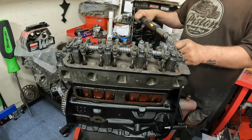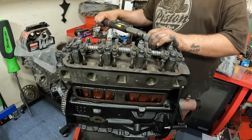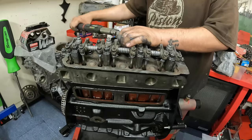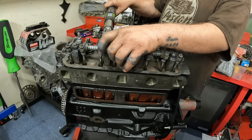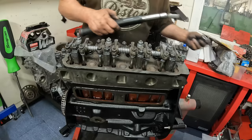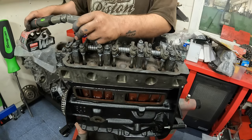And then just quickly make sure that all the rest are okay. Which looks like they are, this is not really moving any. Normally the centre couple move a bit more round when you torque the head down, yeah, you see that one did. And then back down to 25 to check the rocker shaft nuts once again. And that's it.